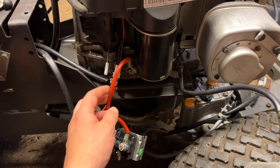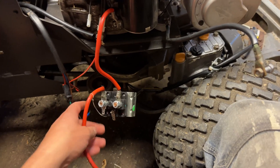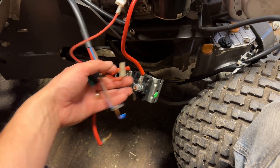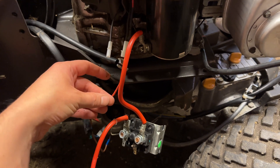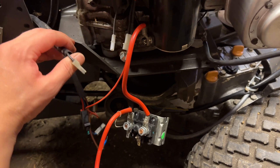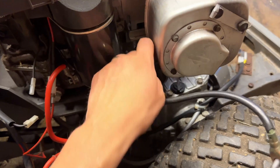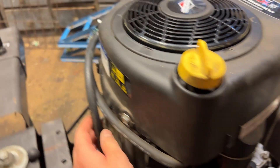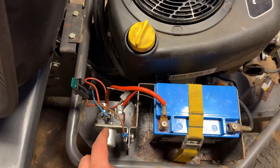This is the plus cable that goes to the starter from the solenoid. This one goes up to the battery and attaches here — the red one is for charging. This is the kill switch, so it should go to this connector, but they don't look the same, so I'll have to make an adapter. The ground goes up to the battery, and of course there's the fuel line. Here are all the electrical connections and how it should look.